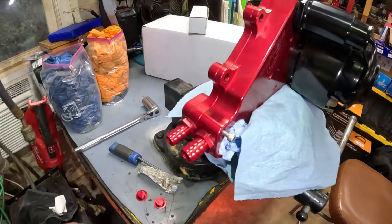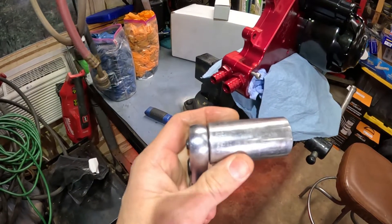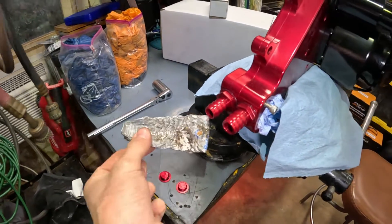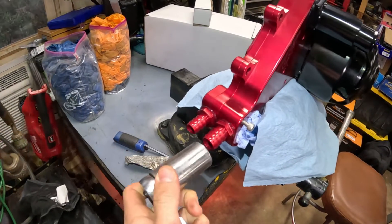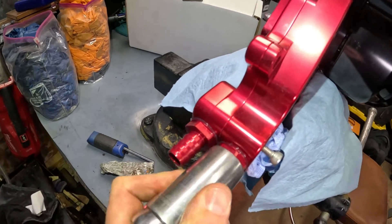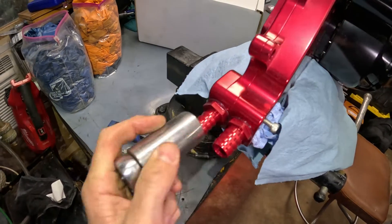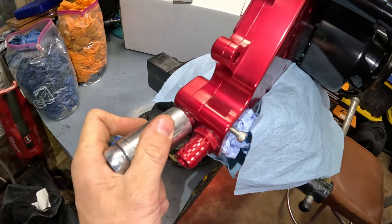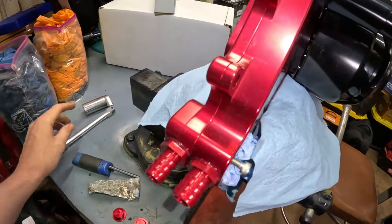We have our fittings installed. Ended up using a one-inch socket. I used dielectric grease to lube the O-ring — it was a very tight fit. If you have a deep impact socket, it may not fit on both. What I did was install one fitting by itself and then was able to get the socket on securely to tighten down the second one.